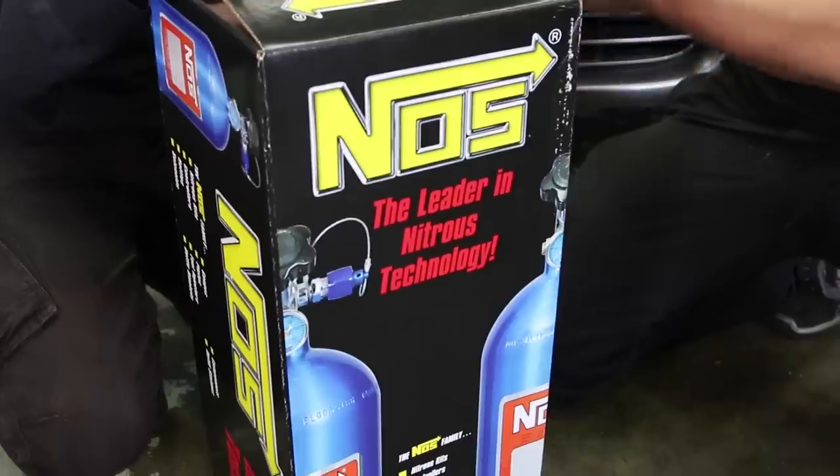We've been coming down here for years. They build race cars, street cars, they import awesome stuff from Japan. But not only does Scotty do that, he's also the genie of the NOS bottle. Scotty, can you give me a rundown on how this system is going to get stuck into the car and make us go faster? What we have here is NOS, which is a chemical supercharger. We take a big bottle out of the back of the car, bring the gas from the back up, inject it into the engine, and then we bring fuel in and inject it at the same time. These two mix together, go into the engine, make a big bang, and we can have a rating of horsepower from 35, 50, or 75 horsepower. The reason we're making more power is there's more oxygen in NOS than in the air we breathe — it's just like using a chemical supercharger because we're getting more oxygen into the same amount of displacement. We're using double the amount of oxygen being injected because of the chemical, and then we add fuel, which makes the bigger bang, which makes it fast.